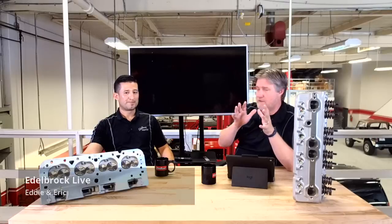That's a great little head. RPM heads always get a lot of feedback from media and people that run and test them — RPM really is just a good, solid street head. The Performer is the next level down below this, and performers are good, but they're more geared for a stock replacement. Not too aggressive, they still have the exhaust crossover. But if you're going to run an aftermarket cam and all that stuff, this is the way to go for those small bore engines.